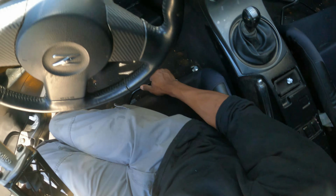You can see, get that in there. It's gonna loosen up one, and there should be one on the other side as well, two. Once we get those out, we'll be able to pop out the airbag and then move on to the next step after that. Okay, so we removed our TT30, not T30. Boom, now we have our steering wheel off. Make sure you have your battery disconnected. So what I just gotta do is, I believe, lift and pop. I gotta figure out how to pop these off, but looks like you just lift the black tab in there and the rest would come off.